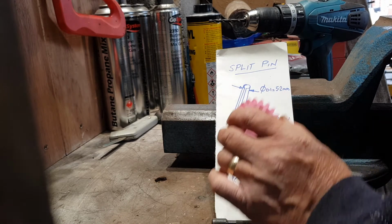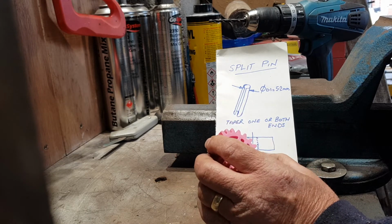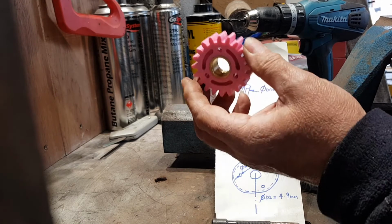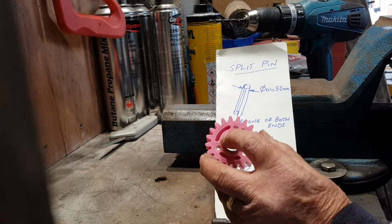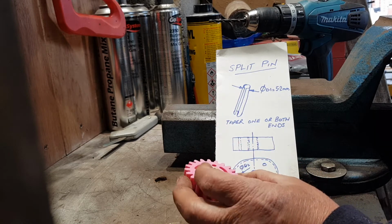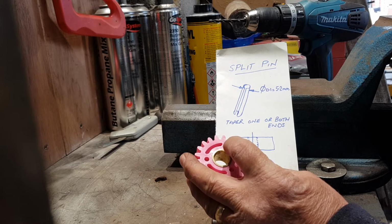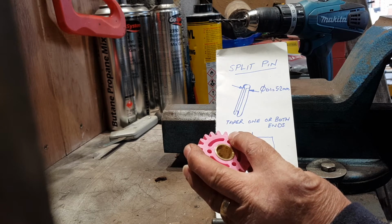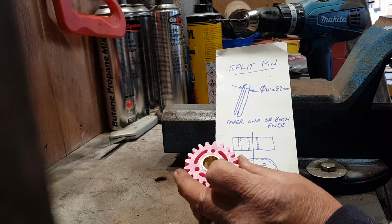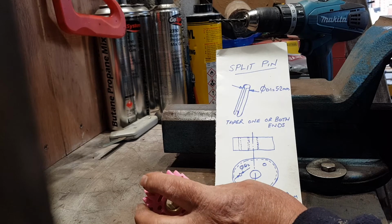So when you drive this pin in, they don't just slide in. When I came to put mine together, I thought, oh, hang on a minute, these don't fit. And then I looked at it and of course realised this is steel, this is plastic. I'm going to drive it in, and what am I going to do? I'm going to pre-stress this area around the gear. So it won't take much if you've already pre-stressed this area for this point to fracture. And I went back to my old gears, and sure enough, it's fractured at every one of those 3 holes across into the gear there.